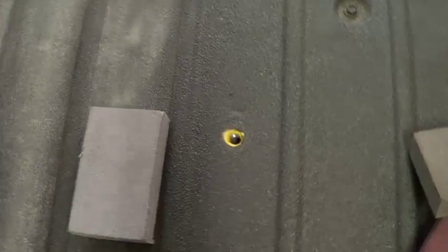I'm feeling a lot more wear down on this, like friction. I'm getting a lot more friction on this than I would if I was sanding paint. I'm really picking up a lot more heat sanding the bed liner. So it is a little strong, and as you keep going on it, you can see it's coming off. I've got a wet rag here just to show how much of it is really coming off in some of these areas where it looks like there's a lot of dust.